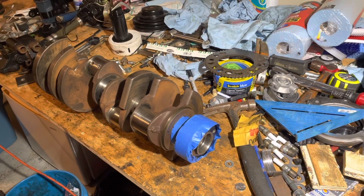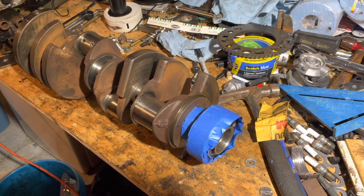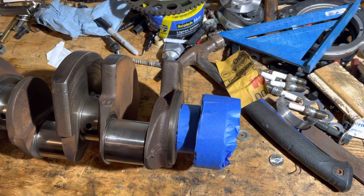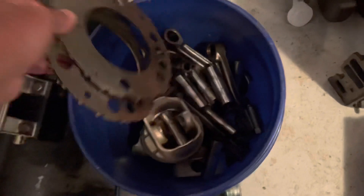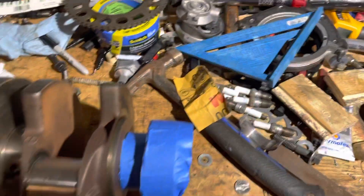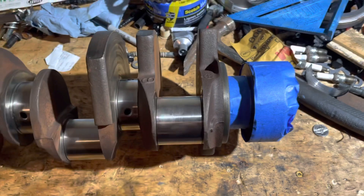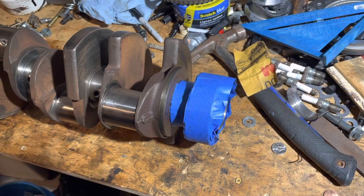I have now removed the 24-tooth trigger wheel off this crankshaft — a 6-liter LS crankshaft around 2000-2001. Before I removed it, I taped over the journals to protect them in case the wheel fell off and nicked them. As I knocked the trigger wheel off, it came apart — there are two pieces to it. I just took a hammer and tapped on it approximately 180 degrees apart, and by hitting it hard enough I was able to knock it off. It's a .007 to .008 interference fit.